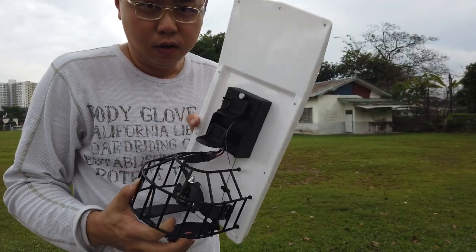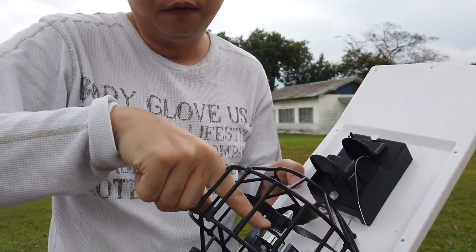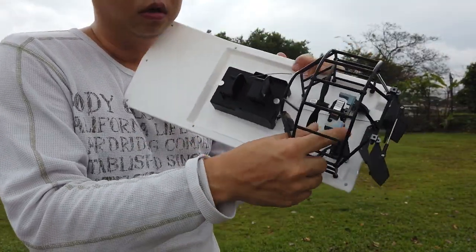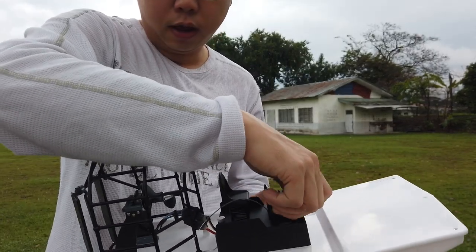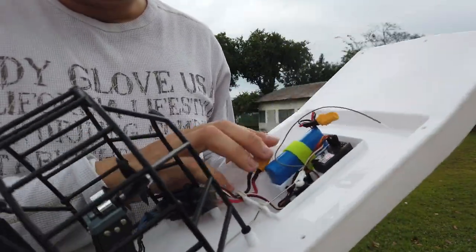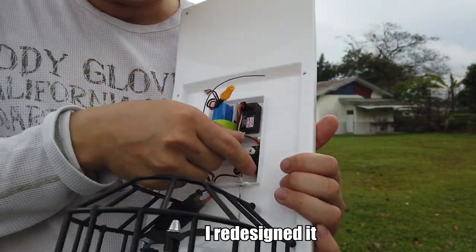So I've assembled it and I have quite a few complaints. One is the propeller — it's terribly unbalanced. I've balanced it with tape which seems much better; before that it was vibrating crazily. Also, the motor shaft size is 2mm compared to the 3.17mm you'd find on RC planes. The motor mount is also quite flimsy and soft — if you go forward it actually pulls forward. I also dislike the battery and electronics compartment design.